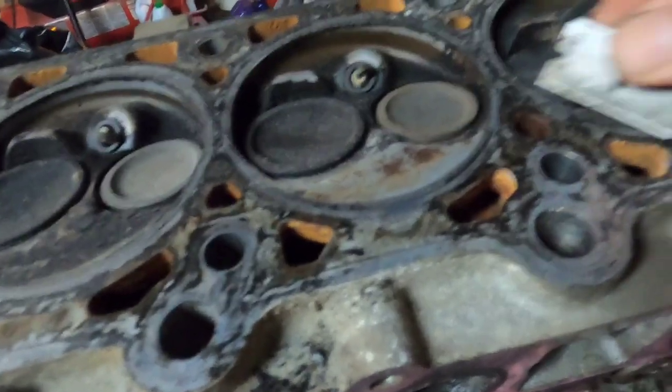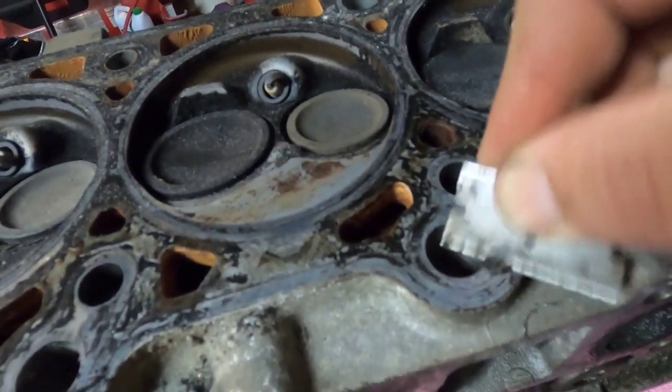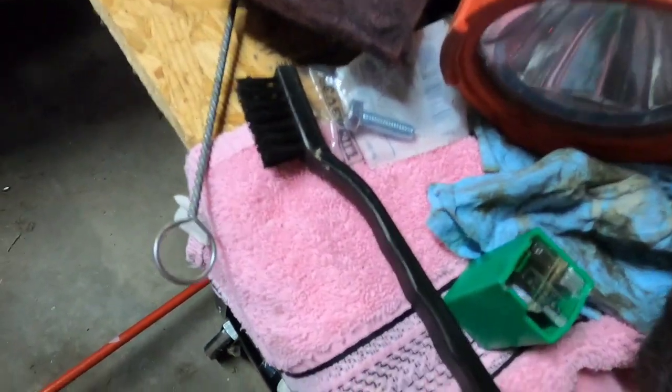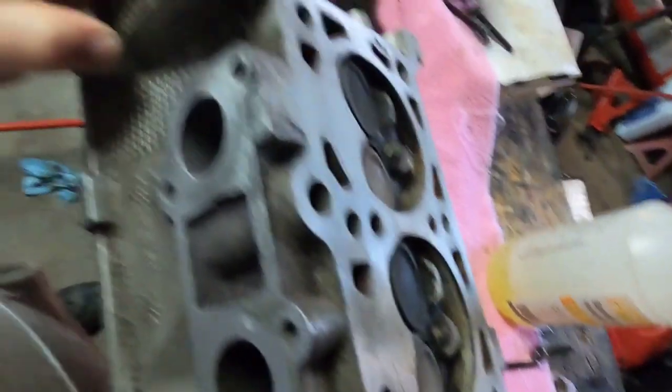Since our little operation here is outgrowing my garage, I'm going to get this thing out of here. What I'm basically doing is cleaning up the gasket surface with a razor blade, just going around and scraping the crucial areas. I'm using a razor blade, scotch-brite pad, and a couple of little brushes. It's all clean — there's the exhaust ports, here is the head gasket side, that's all nice and clean, and then the intake gasket surface.